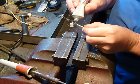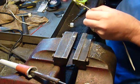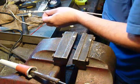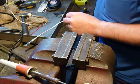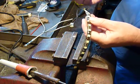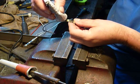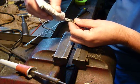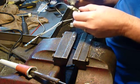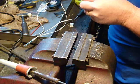Down in between. When you get in between the two and down the joints, it actually helps prevent it from earthing out and accidentally touching when it's being put into place. Do the same on the other end of it, on this one. You don't have to use grey, it's just that I've got grey. I mean, you can use black or white, doesn't really matter. It's not going to hurt it, just as long as you seal it up so it doesn't get any moisture in there, particularly if it's going to be for an outside purpose.